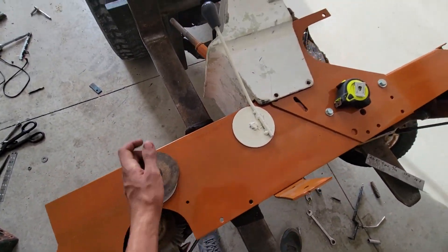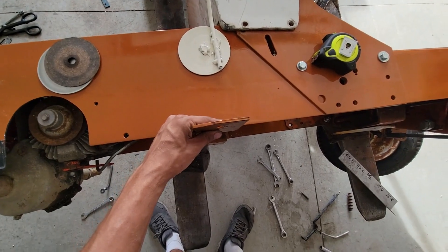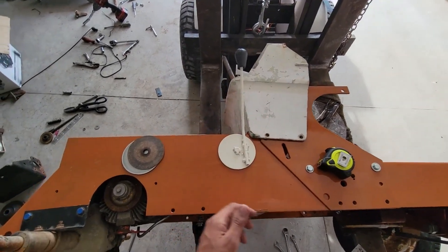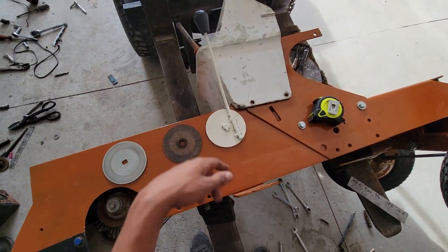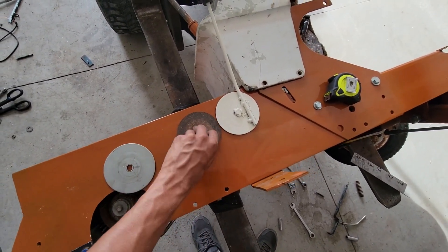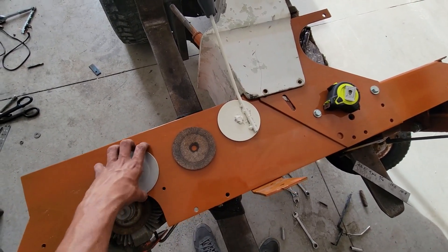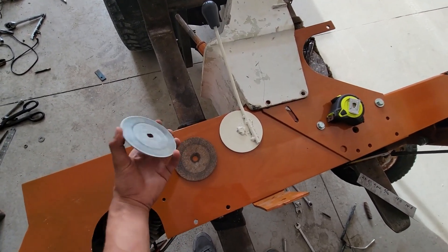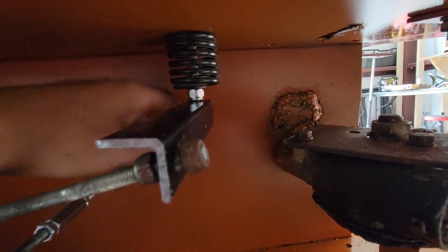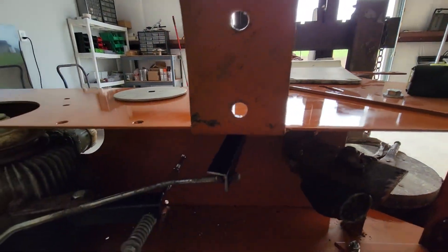On hydro transmissions, if it has a lever, you have to have either a clutch or brake system that kind of clamps down like this. Otherwise, you're pushing the lever forward and as soon as you let go, it's going to spring right back to neutral, just because of the resistance and, basically, the oil pressure. What this is, is basically a cork disc — or clutch disc — and then a large washer, which is part of a clutch. It goes on there and it's got a spring on the inside that is adjustable with that nut, which tensions the spring and makes the lever actually stay in one spot.